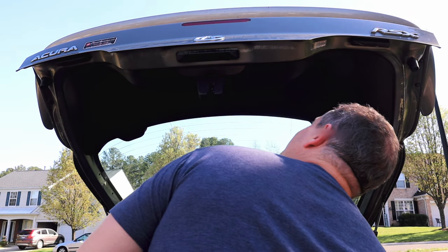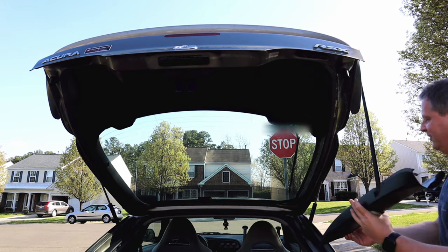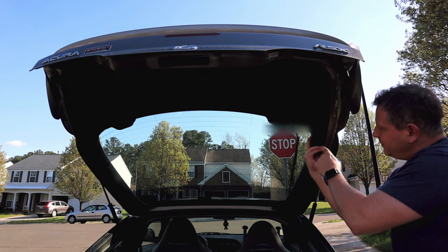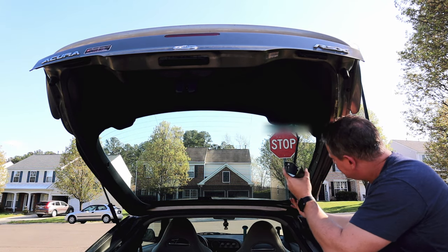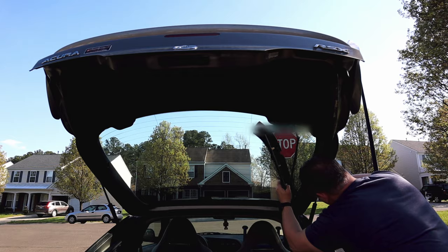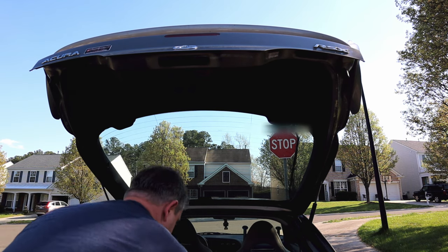Don't forget to reinstall the screw in the pocket. Now that we have the larger panel installed, we're going to install the side trim pieces. Remember — if you're removing these, remove them first, and therefore we're reinstalling them as our last step. You need to push the larger panel toward the front of the car when removing it, and the side trim pieces get in your way. Putting them back on is just a matter of aligning the plastic pins with the holes and giving it a firm push. Don't forget your hangers and the Phillips screw that goes into the hanger.